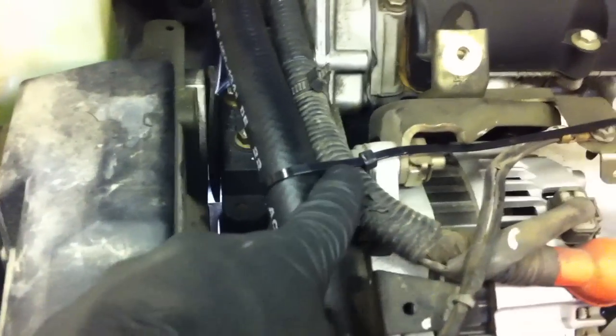If you don't have that belt tool, you can do it from underneath with a wrench — I'll show you that in a minute. Also, you might take this air conditioner hose right here — I've got it wire tied because it sits right in this area and it's kind of in your way, so wire tie it over and that'll give you a little room in there.